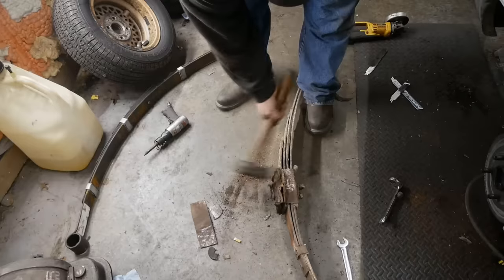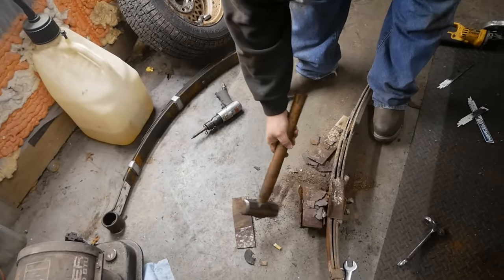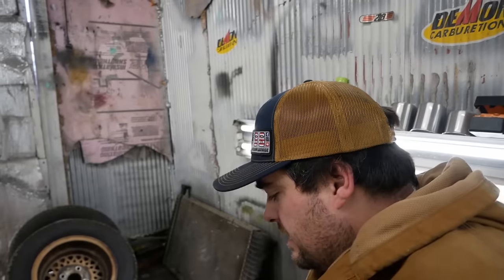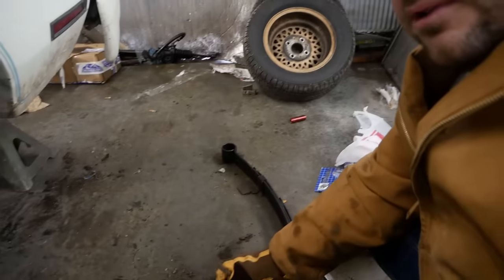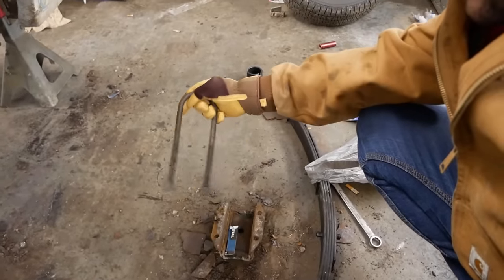Oh my god. Yep, the center pin plate is broke again. Back out here today, I made a run to the farm store. Unfortunately, they didn't have the correct U-bolts. Supposed to be a 7/16, 2.5-inch bolt, and these are half-inch, 2.5. That was the best I could do. So what we'll do is we will just drill out the plate and upgrade to the bigger U-bolt.